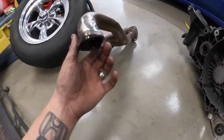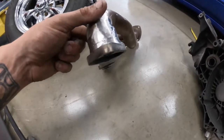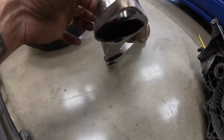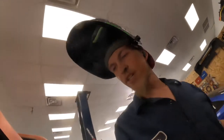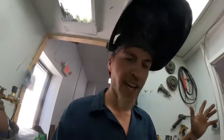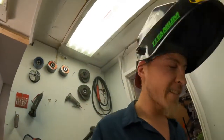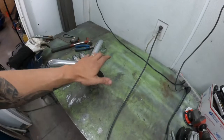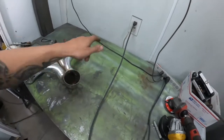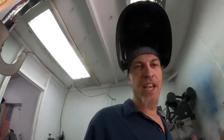I was in the midst of cleaning these up and then I got to looking and the flange is just warped — super warped. So I reached out to the customer, said, 'Nacho, can I chop these up?' He said, 'Do what you got to do.' We're going to Cerakote these black, so for all you guys worried about the chrome — don't be mad, they're going black. I'm going to mock this up and then kick it with another pie cut with three-inch pipe and put my flange on the end.